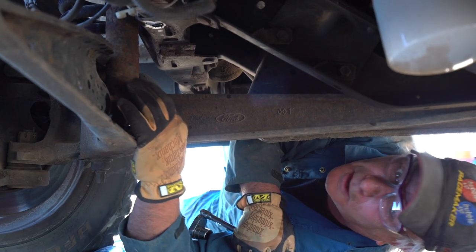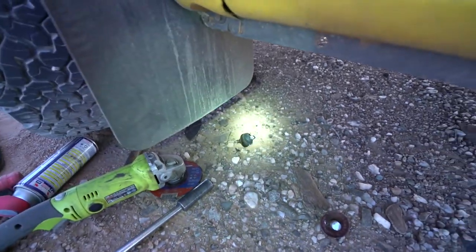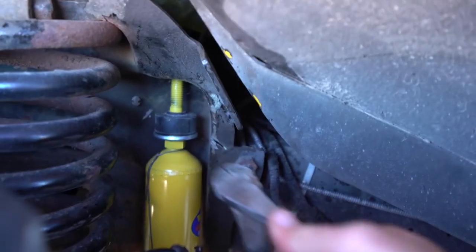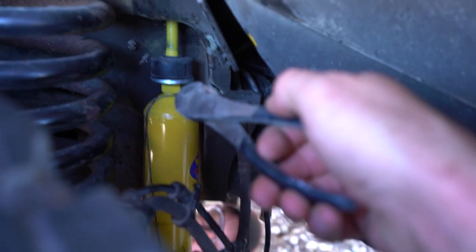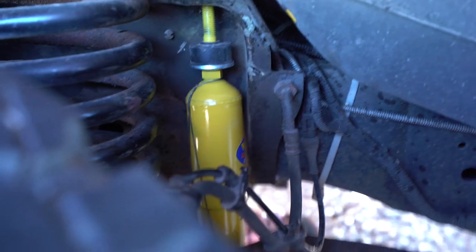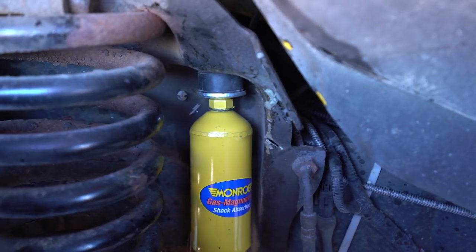Good work, Badge — we're doing it. Alright, this is the final life of the shock. It's coming off. We got the vice grips. Way to go. So, 20 minutes later, we got this shock off. You have to compress the shock because you can't get it in there. What we did is we wrapped the top and the bottom with mechanic's wire to keep it compressed so we could get it in the hole. And all you got to do is just clip it — just cut the wire. And then up the shock goes. You just remove all the wire. That's a nice tip.